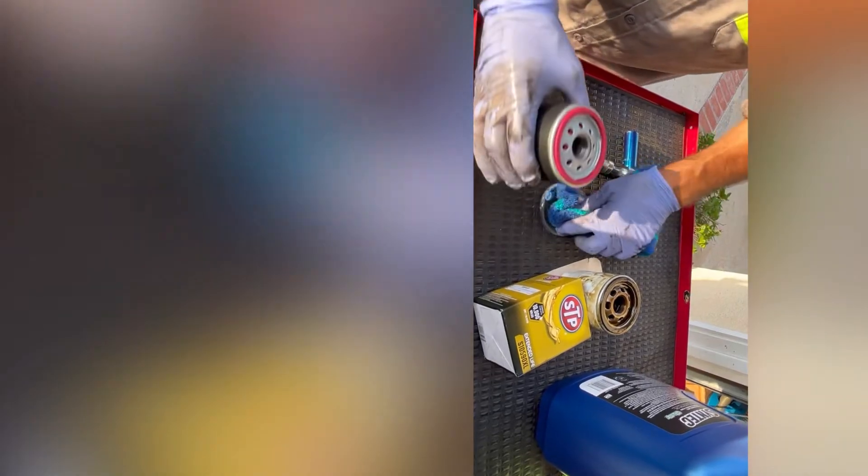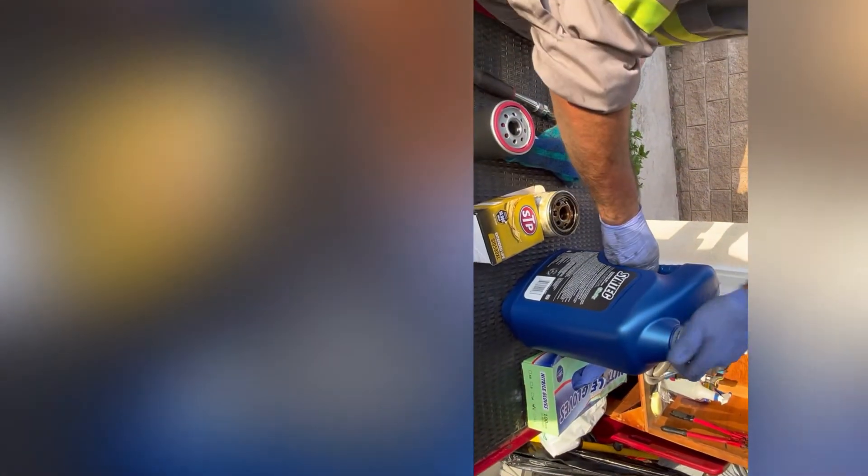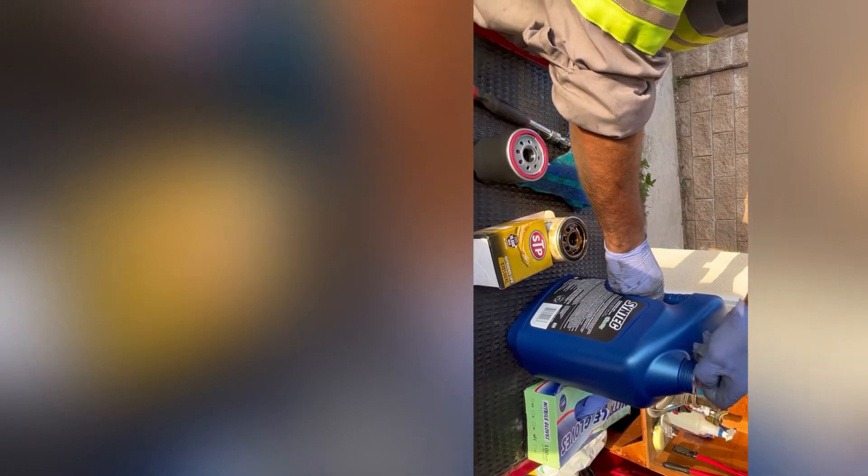On the new filter, you always want to put new oil around the lid — sometimes they put some oil inside too. Put the new one on. Before I do that, open this up — a little oil, just a little dab on my finger, rub it around. As you see, that makes everything easier. Now they're not supposed to be real tight where you need pliers or any special tool to get off — you're only supposed to make it snug hand tight. See, there I go, right in.